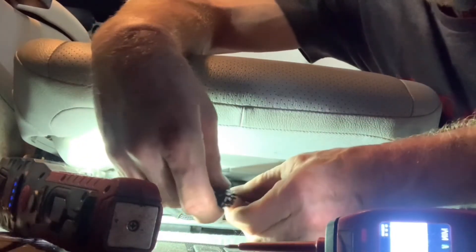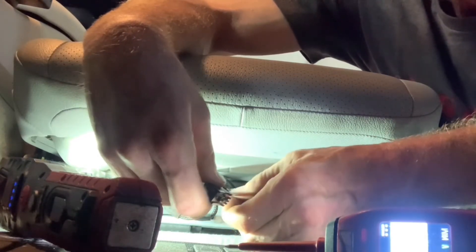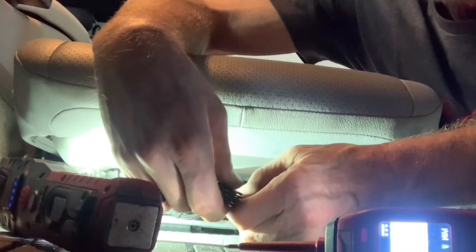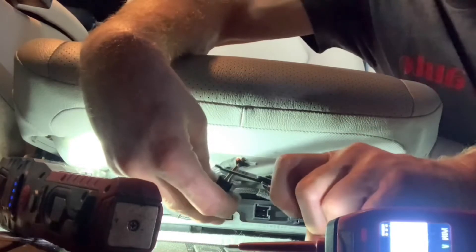You're going to attach the pink with black wire to the red with the green. That way there will be power on that module to wake it up, and it will work — it will only come on with the key on.